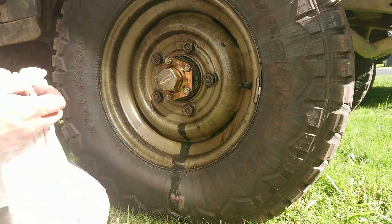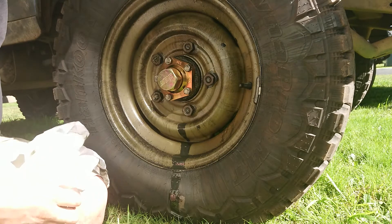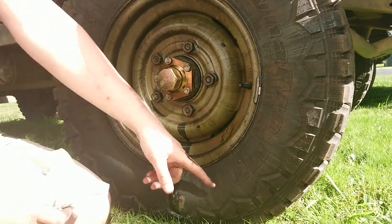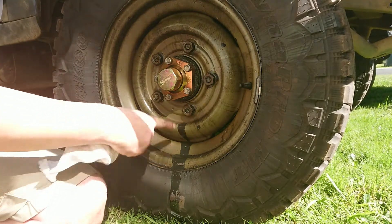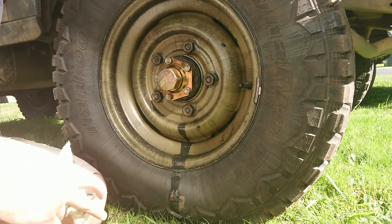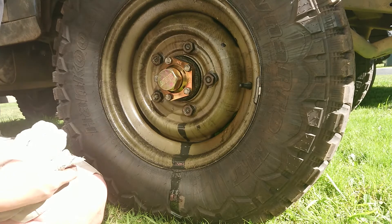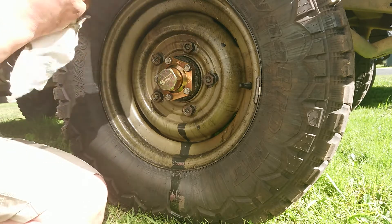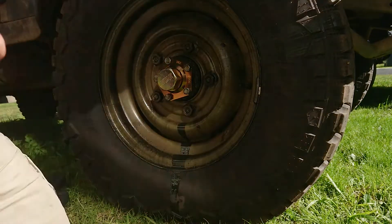I think that's on as tight as I want to put it on. It's time to pack up - I'll let this set for a few hours. I might take it down to the car wash and clean everything off because you can probably see there's lots of stripes along here where the oil has started to degrade the rubber on the tyre, and that's one of the biggest things I'm worried about. This for now should at least stop the leaks. I will pull them back off once the hoist is on and I'll take those inner seals out and repack the bearings. But right now I just need it to stop leaking and be functional enough to get to the shops and back, because during lockdown that's really all we need to be doing.